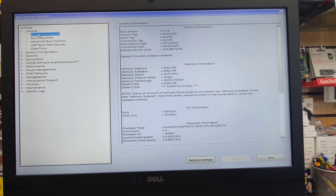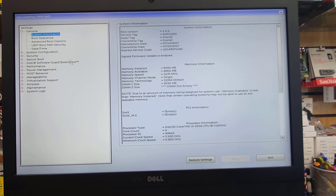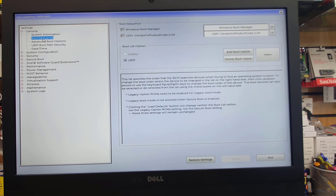There are a few settings we're going to change to get a successful UEFI boot. First of all, in the boot sequence option you have to choose UEFI. If you have it selected on legacy, please change it to UEFI — that's the first thing we need to do.